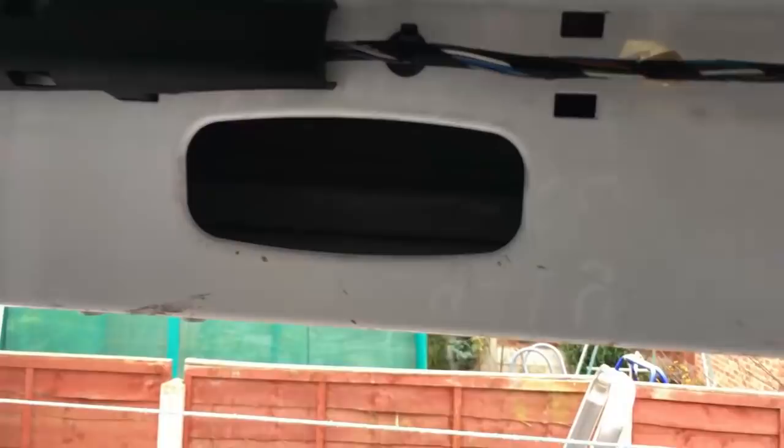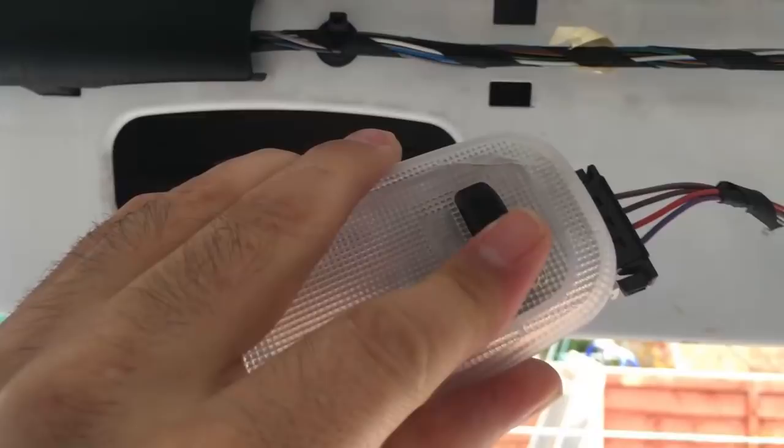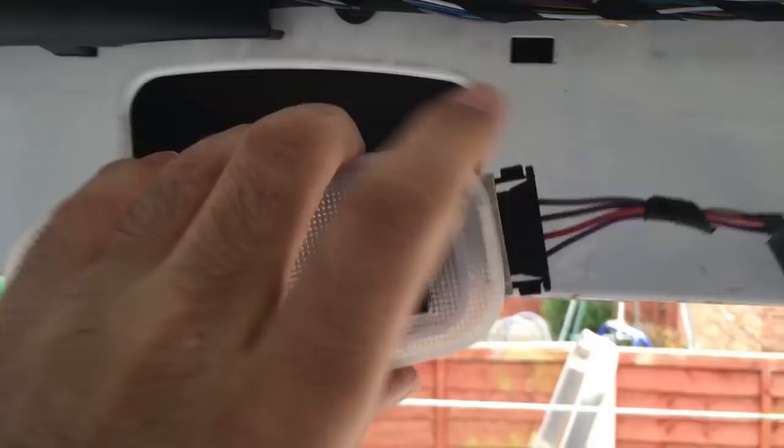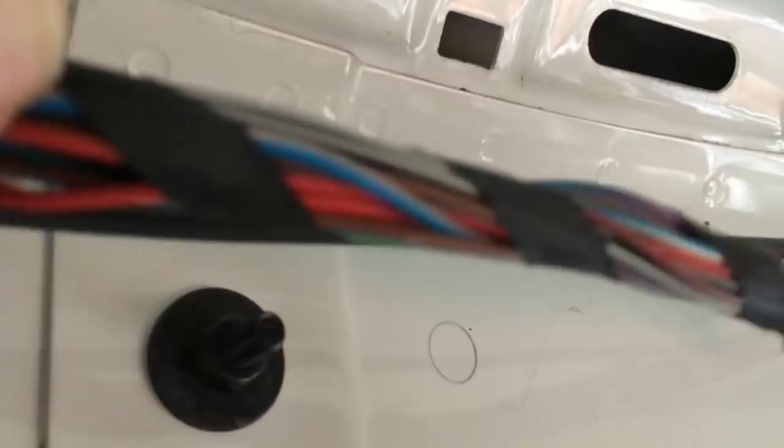I'll connect it above the headliner once I remove this light to get access and pull the cables in. I need a 12-volt supply here for the camera. With the light on but no ignition key in, there's obviously a permanent 12-volt feed — I'm guessing that red wire is a permanent live which I can use for the camera. A little further along there's a ground bolted to the chassis, giving me my negative. In the wiring loom running front to back there's a red cable for permanent 12V and a white-and-red cable that brings on the reversing light.